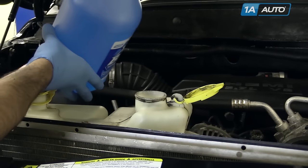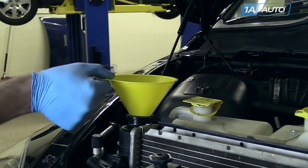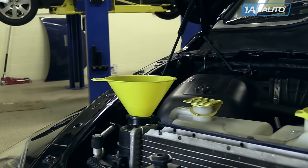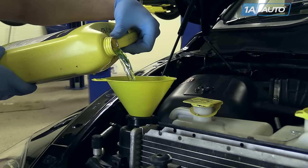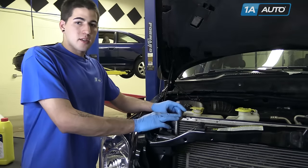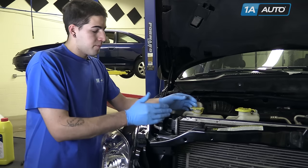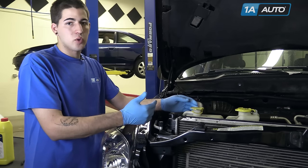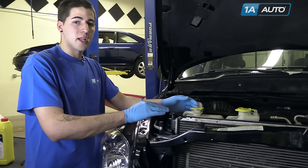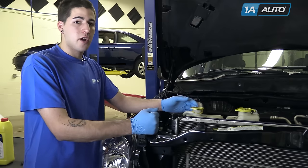Refill your washer fluid. Fill your radiator with Mopar approved 50-50 coolant. Anytime you drain the coolant from your vehicle, you're going to want to properly bleed the system. To do this, fill your radiator and your expansion tank, turn the heat on in your vehicle, and let it run. With the cap off, wait until you see all the air bubbles come out, constantly checking the fluid level until it remains stable without any bubbling or draining. Then you're safe to reinstall the cap. Ensure that your heat's blowing hot air — you're ready to go.